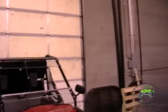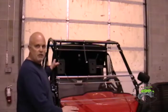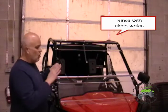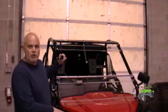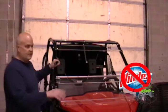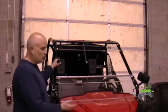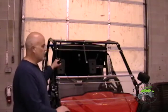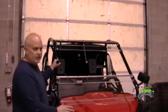Drop it down like that. Also, one of the advantages — this is how you want to clean your windshield if it gets dirty when you're out riding. Tilt your windshield down, rinse it off with water, dry it off with a clean cloth. Where windshields get scratched — mar or non-mar — they will all scratch if you spray Windex on them. Windex is the biggest nemesis to plastics as a whole. Don't use Windex. Water is your best method. Soap and water is fantastic. Dry with a microfiber cloth.